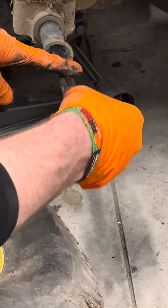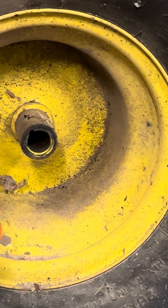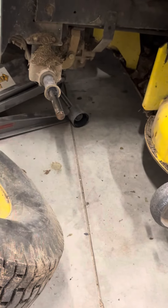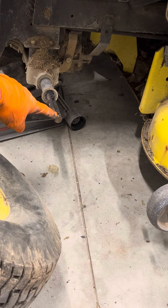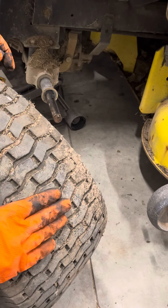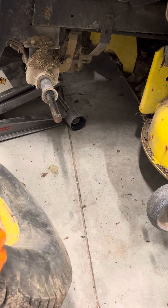What this does — this sits in a slot in this axle and it sticks up. And on that wheel you can see there's a slot right there. This piece of metal sits down into the keyway in the shaft on your transmission right here, so it's locked with your transmission shaft. And then when you put your tire on, it locks it in up here so that whenever that transmission is moving, it's locked to your tire. If you do not have one of these and your tire is on, you will get no power to this wheel to thrust it forward — this will just sit and spin and it'll never grab your tire.